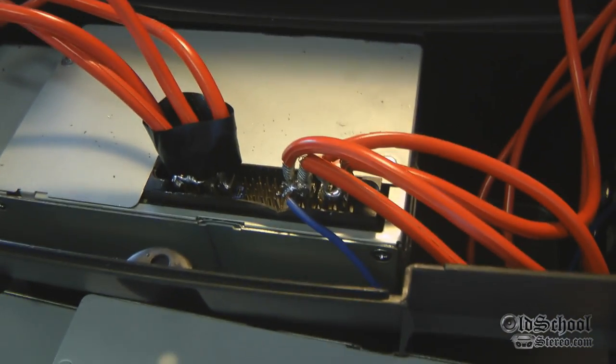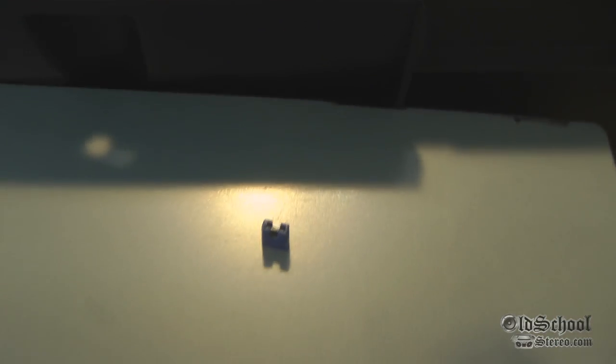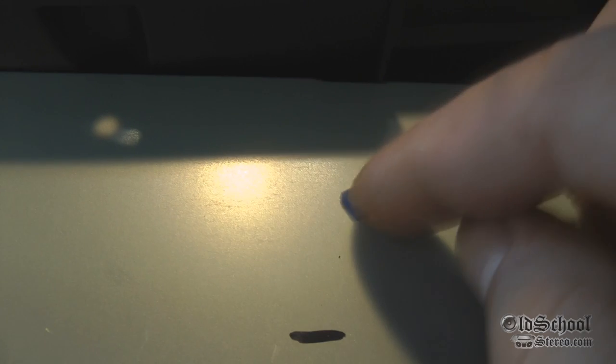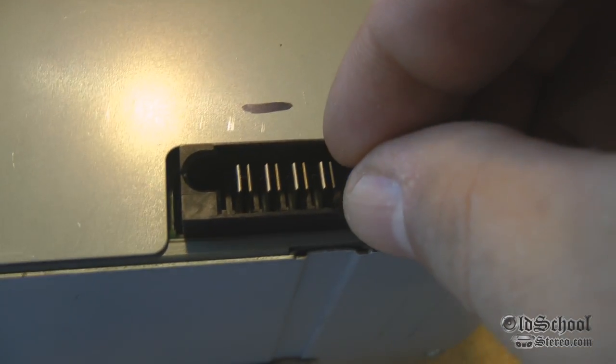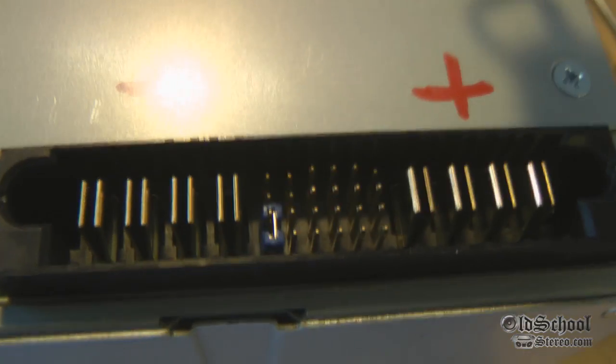If you're lucky and have a lot of old computer parts you've probably got some of these little jumpers sitting around. They were designed for old IDE drives to do master and slave. If you don't have one, a computer shop near you probably has a ton of them and will give you one for free — all it does is jump the pins together. So I just slid it in and now we're good to go.